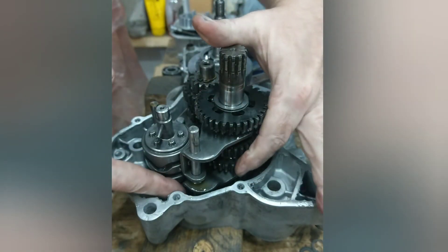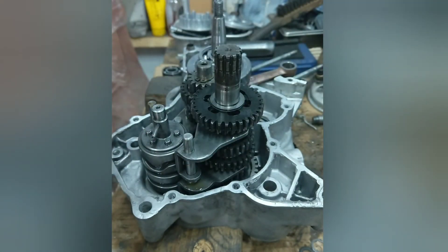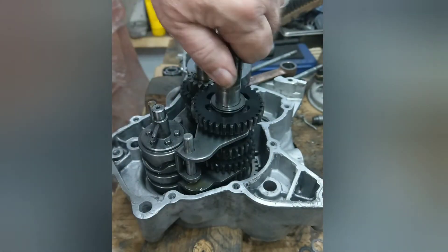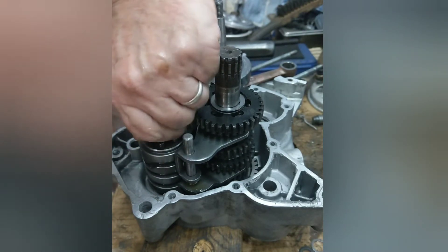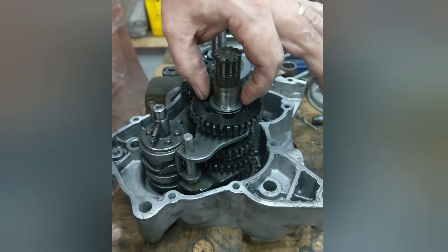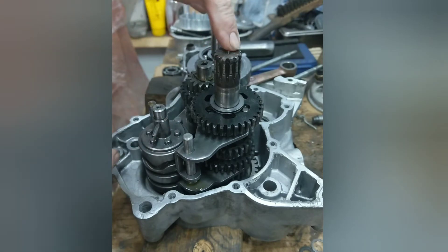Another thing is if you put too much oil in that hole at the bottom you can cause a sort of hydraulic lock when you try to get that in. That's that right in. Now the other shims that go on these gear trains — that shim there eventually goes through the other casing, that's where your sprocket goes onto.